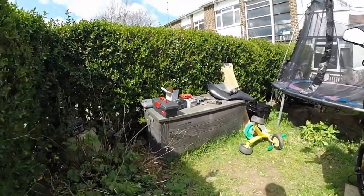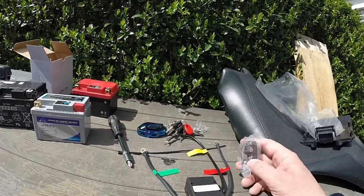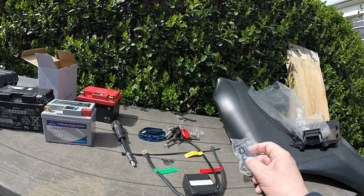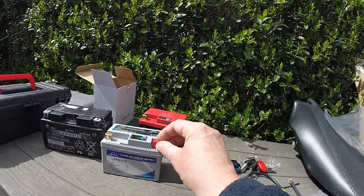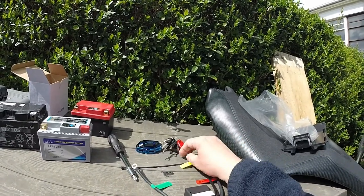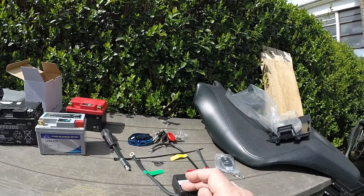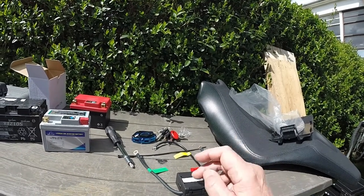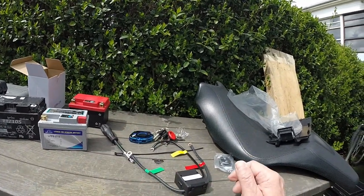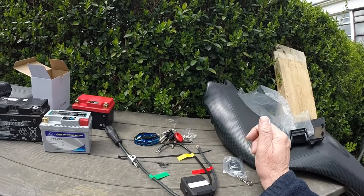What I mainly want to do is isolate the battery. This is a battery isolator — it's a remote controlled isolator. I'll put a link in the description where you can get them from for about £23. Basically your positive cable comes off the battery and goes onto the output cable here — that's your output end. These two connections are your positive and negative for the battery. It goes through this system and controls whether power is sent to the positive you've taken off the battery and placed onto here. It comes with the nuts and bolts to do it.